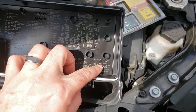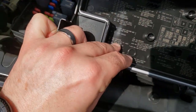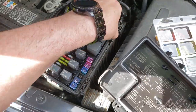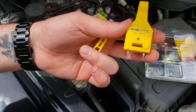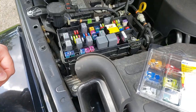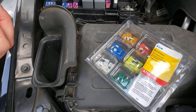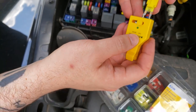M36 is a power outlet and M6 is also a power outlet. What's neat is I didn't realize it had a fuse puller already. I also bought this little kit from Home Depot — it comes with a fuse tester and a fuse puller. I'm going to use the Jeep's puller. I don't know which power outlet fuse is the issue, so I'll pull M36 first and then M6.